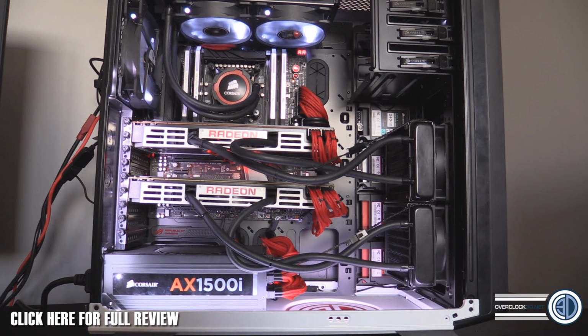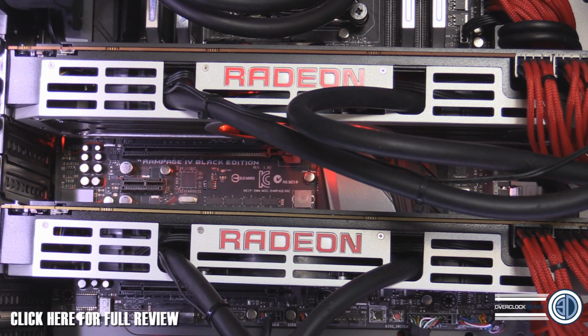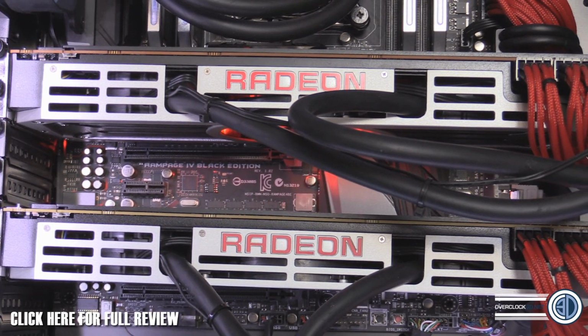One thing that we can see, if I zoom you in, is that the lower card is dormant. The AMD system will shut it down, so the red light goes off. Until you activate some 3D load, it kicks into 3D mode, then that light pings back alive again, and it all starts running properly.